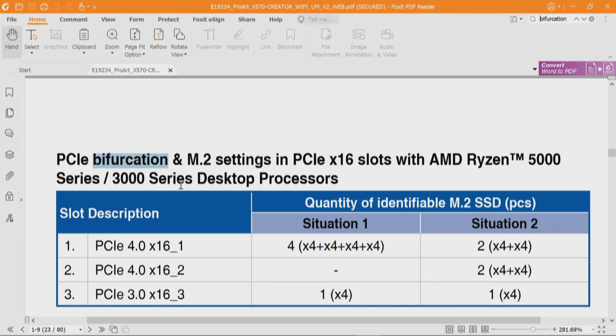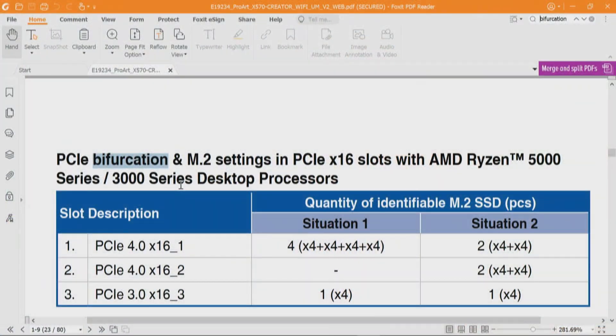You're shy on VRAM based on the CPU. The formula is CPU cores times four equals RAM — so with 16 cores, that's 64 gigs of RAM for a nice balance. And then CPU cores equals video RAM — so if you've got 16 cores, you want 16 gigs of video RAM on that GPU, which you don't have. For a balanced, purpose-built machine to do rendering, the GPU can do around 80% of the rendering, and it's all about CUDA cores if your rendering requires that.